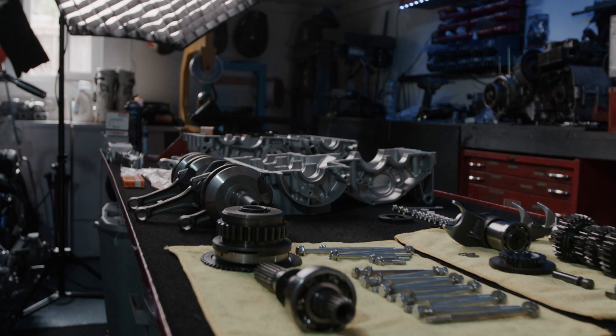I've gone ahead and thoroughly cleaned both cases of our engine. It's super important after you get things vapor blasted that you do a thorough cleaning, because the media they use to blast the cases is super fine and if it gets into your oil passages or is on a bearing surface it may ruin something. I've cleaned everything — the only thing to do now is put the engine together. These CB550s with the top and bottom case are an extremely easy build, so let's jump into it.